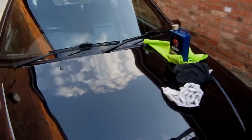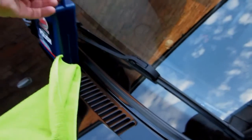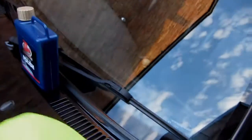Well, that's it, basically done. I've washed the windows with just some washing up liquid and a sponge, so you don't put it on your front screen or your rear screen. And say, this is the final buff cloth, one of those microfiber ones, very good. An overall polish. I do all the water traps as well. Most people forget this bit here, all down the door recess and the catch area here, all the sills right down to the bottom there, top of the doors, all the way down, water trap. It'll all protect, might stop water collecting. It'll just bead off.